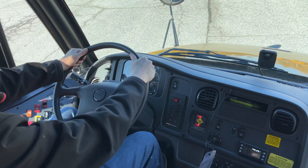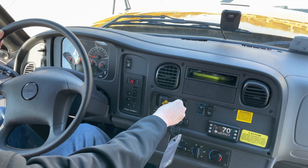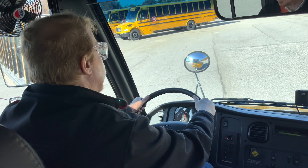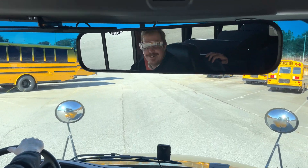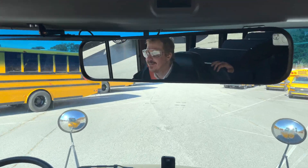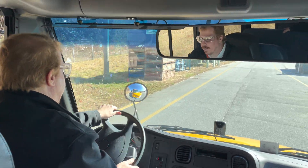To turn off the Intellipark, put your foot on the brake and push that lever forward. Lights are off — you're good to go. Push it into L, apply power, and we're good to go. I'll go ahead and accelerate and let it shift into second to stay in the power band, and then you'll feel it come back on again.